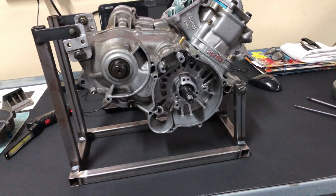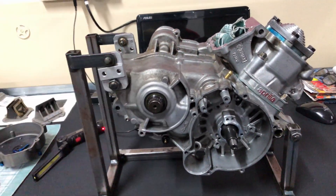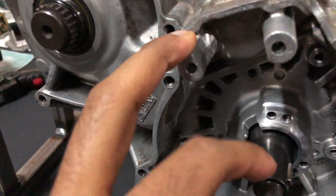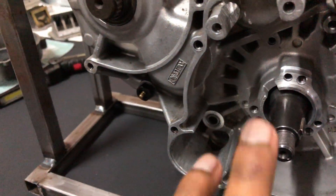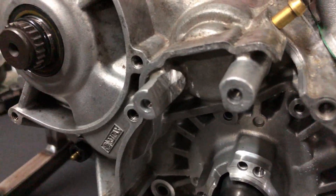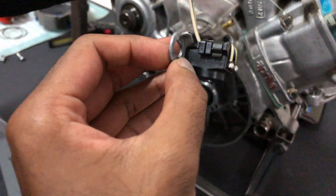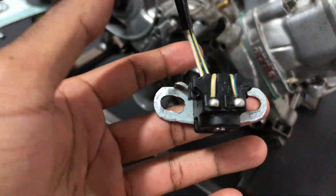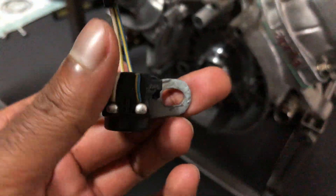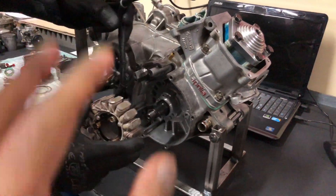Okay, we've got the engine on the workbench — now I'll be showing you guys how to advance timing. It's pretty simple and not complicated. As you guys can see, this is the modification we had to do on the engine housing: this is the pickup mount. You gotta be careful with a dremel tool not to poke a hole in the engine housing. This can easily be done with a dremel or a file. The pickup sensor modification is simple — we enlarged the bolt holes and made them oval so we can move the sensor from side to side to advance timing.